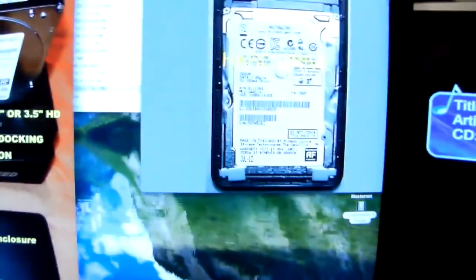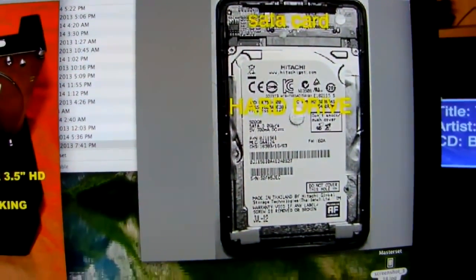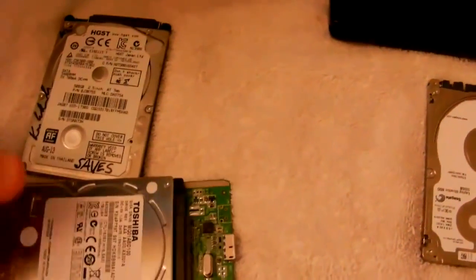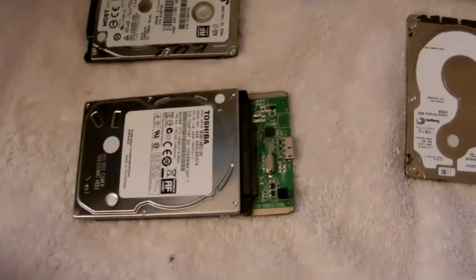On an example of a Hitachi hard drive, you have the hard drive inside its little casing. Once you get the clamshell open, you can see the SATA card right here — this little green controller board right here. This is the bane. There are literally millions of hard drives thrown away every year because of this little cheap part that's worth about 50 cents, and it's always failing.